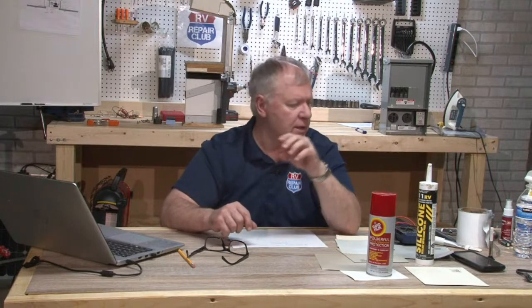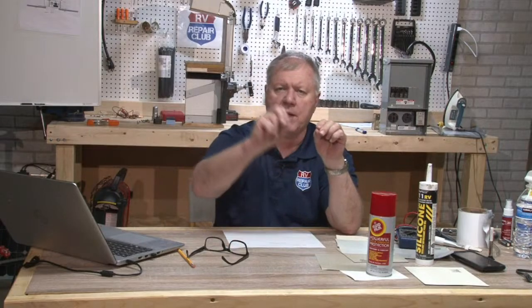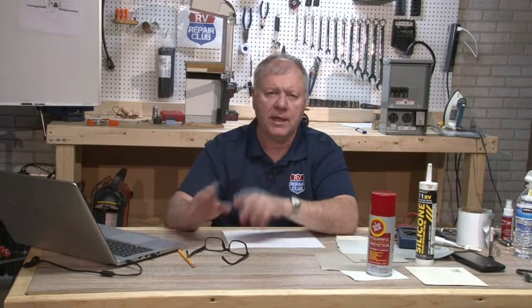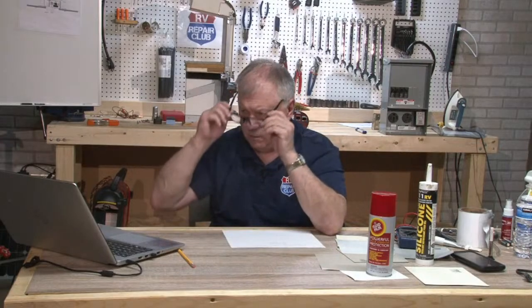So I would get a multimeter, and, you know, you don't even have to do this. Something as simple as a light tester, ground one end and find out which one's the positive, which one's the negative. So you know that you're hooking those up in the correct way. But you should be able to just take two screws off, pull that light socket off, test that wire to make sure the wire's good, and then shut your power off and install your LED lights just like normal.